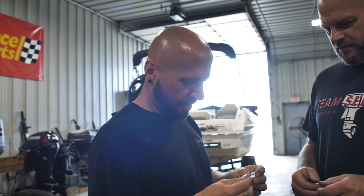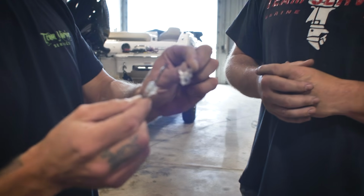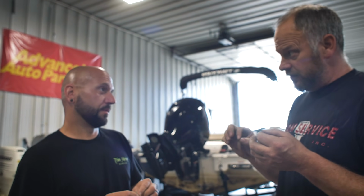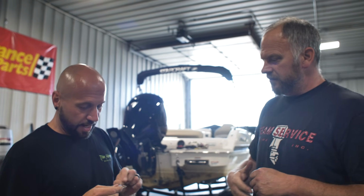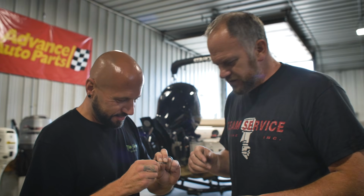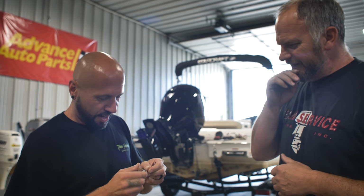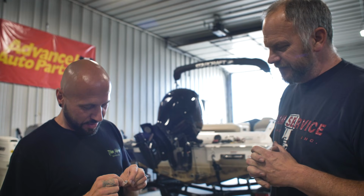This is a connection I replaced in a boat. Why would you replace that? Well, twisting wires together and then just siliconing over them. Maybe they read directions that said twist and solder and they thought it said silicone. It's not good. It's not waterproof, because it's not even fully... Oh, that's where it was touching, though. Oh, the solder. Look at it. See? One drop of solder. Kind of how we don't do it. I cut it out and put crimp heat shrink terminals.